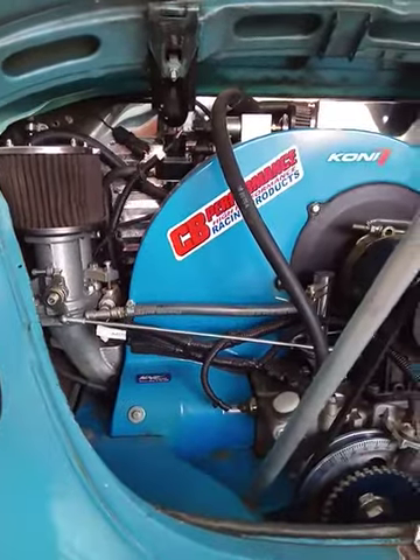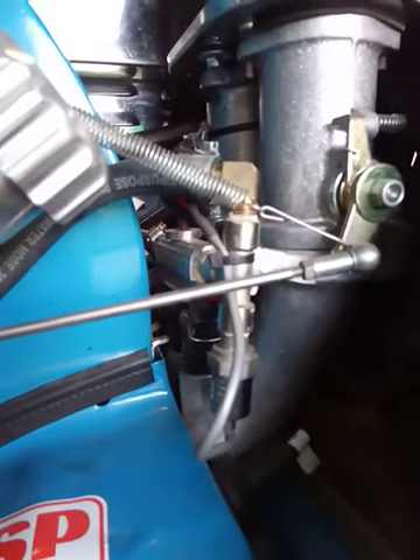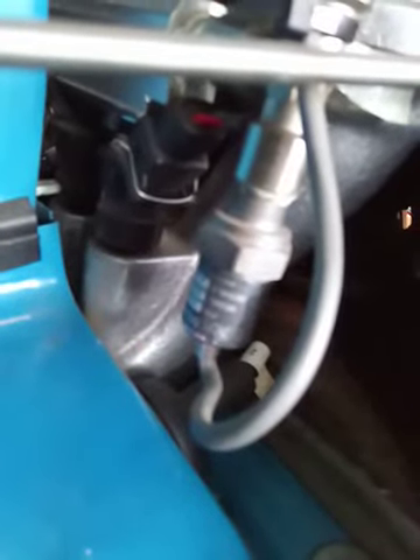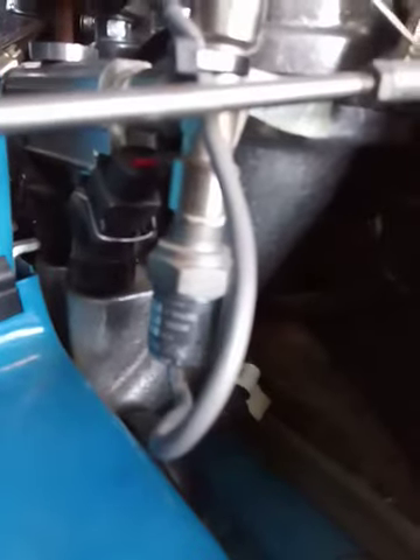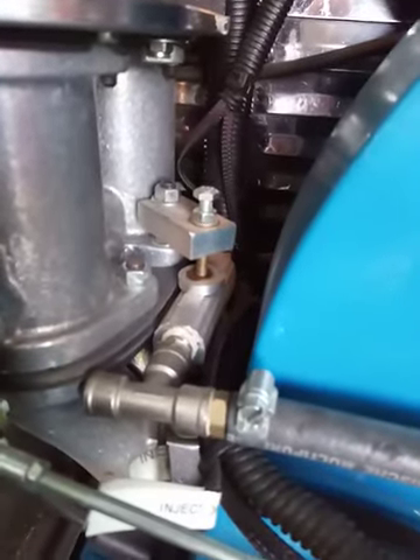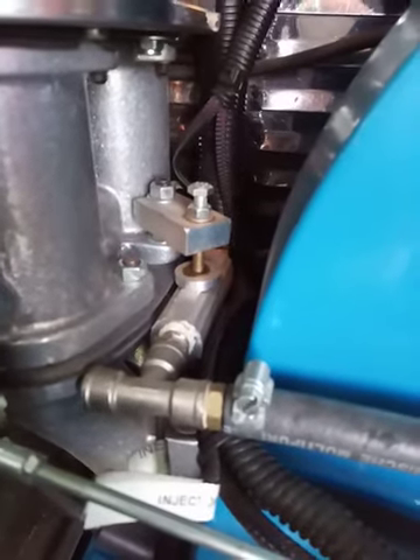Another con regarding the fuel injectors: with the big beef manifolds, I've had to turn my fuel injectors forward-aft instead of inboard. The reason is that with the big beef manifolds you cannot get the plugs on the fuel injectors with the fan shroud installed. So I had to notch the fuel rails slightly — you can see the notch to get the plugs on and off. I've had to do this for all the injectors. Also with the big beef manifolds, the install kit for the fuel rails doesn't actually reach the fuel rails, so I've had to make my own fuel rail retainer — a simple setup to push the fuel rails down so that the O-ring seal works the way it should.